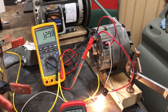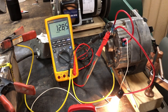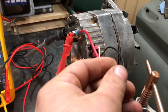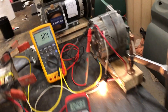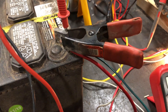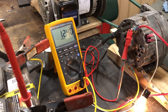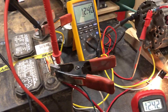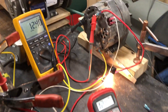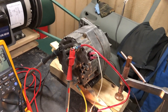Now I'm going to change the remote sense wire — moving it over to where it's tied into the battery instead of jumped directly to the alternator output. We should see a higher output voltage from the alternator. In the previous setup we saw 14.8 volts on the alternator output. Now because it's regulating off of the battery voltage instead of the output voltage, we should see that voltage at the battery and slightly higher over at the alternator output.